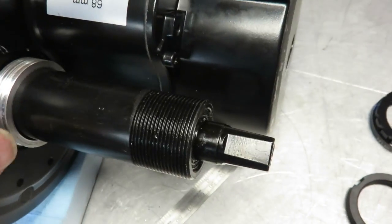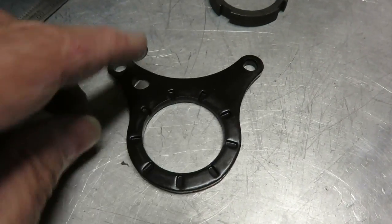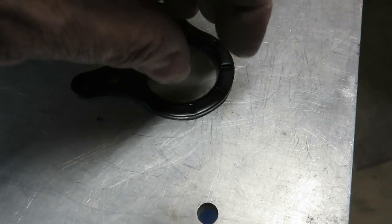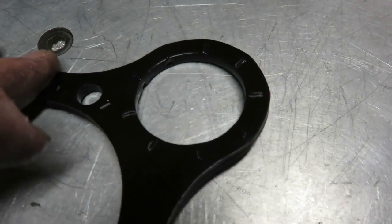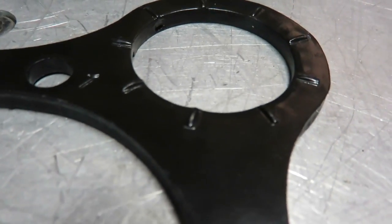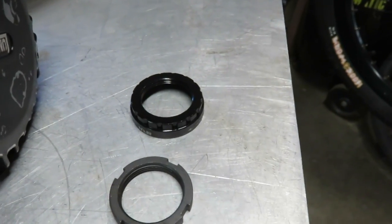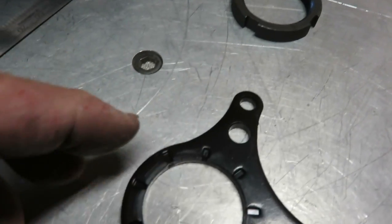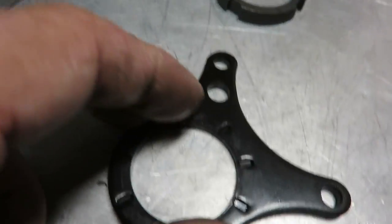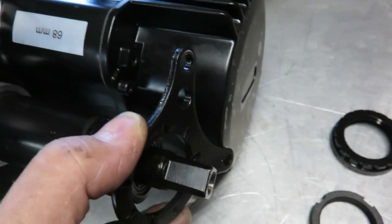After the unit is in the bottom bracket, I'm just going to walk you through it here when it's off the bike. Let's take a look at this part of the bracket. You can see that there are some indents, but this is the side where the machine has actually pushed through and created these raised areas that will bite into the bottom bracket shell of the bicycle to keep the unit from rotating. So I'm going to slip that on now, making sure that the raised area — not the larger recessed area, but the raised area — is towards the center of the bike.